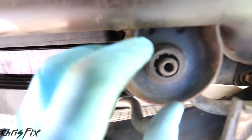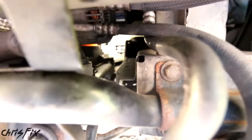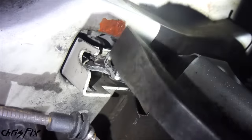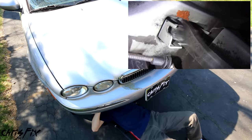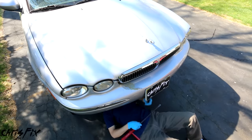Sliding underneath the car — the radiator is right here, this is a radiator mount. We want to see where that hood releases, and you can see right at the edge of my finger that's where the hood release cable fell off, and right there is where our hood releases. Just get your pry bar, send it up to the hood release, aim as best you can, and slide that latch over just like that. Now that's how you open a hood that doesn't want to cooperate.